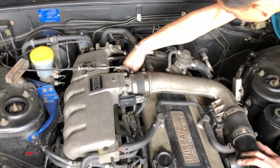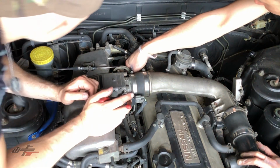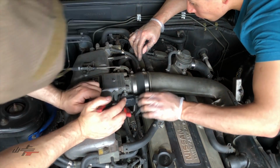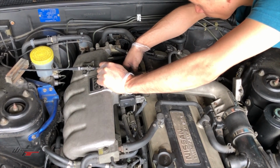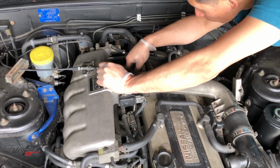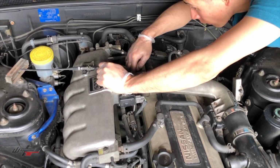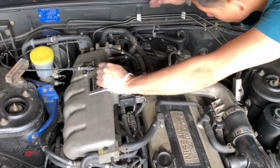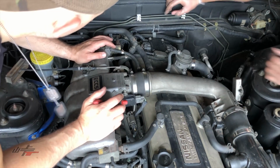Okay, you want to make sure you connect this one underneath the throttle body here first as well, because this one is hard to see. It's often missed. In fact, this line is broken, so we might need a new vacuum line for this one. Did we just break it? No, they usually break. So we take that size hose to the auto parts store? Yeah, it's just a regular vacuum line. Can we drive with the other hoses still connected? Yeah, it'll drive.